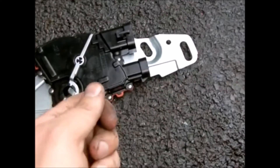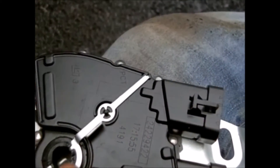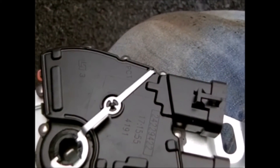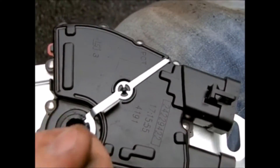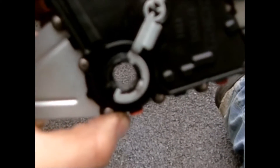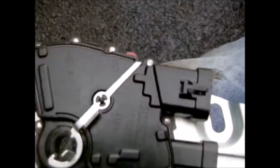On the transmission shaft there's a little flat slot. Take a small crescent wrench and put it on the shaft. You want to turn it clockwise all the way until it stops turning, then back it up two clicks — two detents — which puts you in the neutral position. The shaft isn't a perfect circle, so the switch locks onto it, and backing up two notches puts it in neutral so the switch slides directly on.